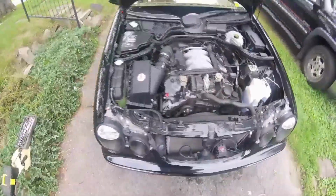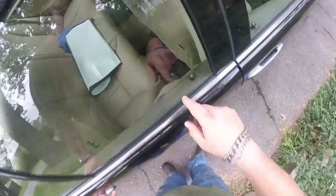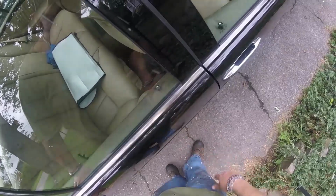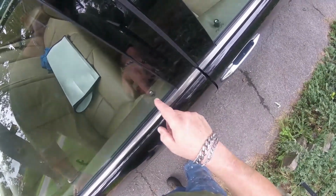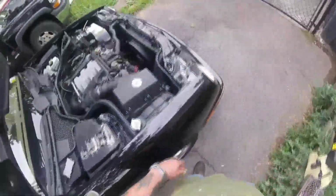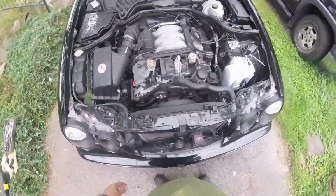All right. Next, you're going to disconnect your battery cable. That's an 11 millimeter or a 7/16. There's a little access port under the rear passenger seat on a left-hand drive car, and it's an 11 millimeter or a 7/16. Just unbolt that. Take your battery cable off. You don't want to have any live juice when you may have gasoline around.